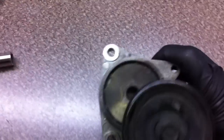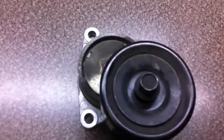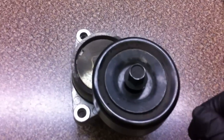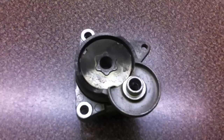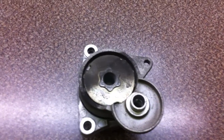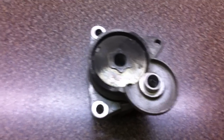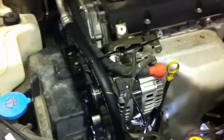Here's the old tensioner — it sits about like this on the car. There's your top bolt and your bottom bolt. When removing the tensioner, if you want, you can unscrew the bolt and take the pulley off to give yourself more room so you can get your hands and fingers up in there a bit easier. Of course, put your belt back on and you should be done. Thanks for watching.